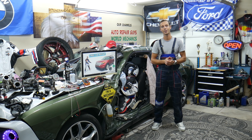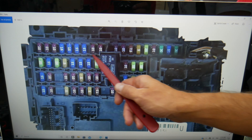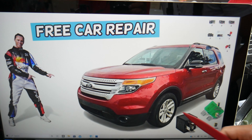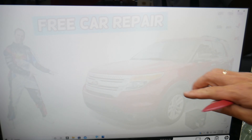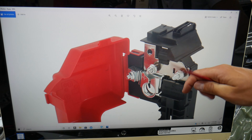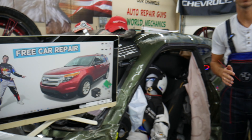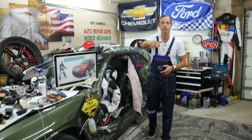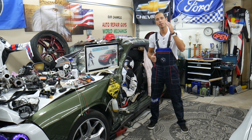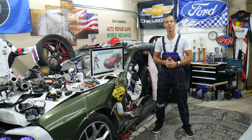There are practically no relays to check for the power outlets — it's a body control module function, so you only have these fuses. Keep in mind there are all kinds of different fuses, relays, and circuit breakers, and things get even more complicated under the hood. There are also some special fuses — one time we needed a replacement fuse and couldn't get one, and we were stuck in the middle of nowhere. We recommend buying some spares and keeping them in the glove box for peace of mind. We'll share a link in the description where you can get them at a good price with quick shipping.